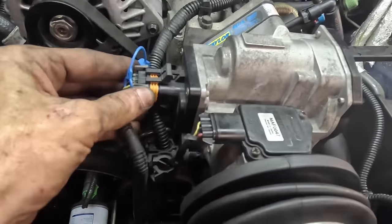Down below, we also have no leaks. We go ahead and shut this thing down. We'll check the oil level, and then we'll back it out and fill the cooling system. Let's see what that brand new oil looks like after 30 seconds of runtime. Looking good. I'm a tad overfilled. Look at that. 5 quarts is a little much. I'm gonna have to drain that out. Yep, tad over. Oil's looking good.